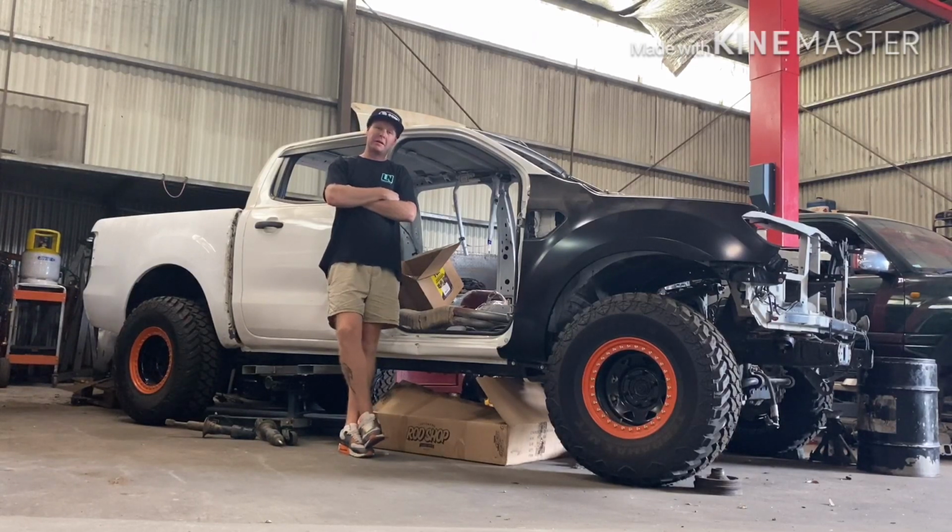So we've got the spare wheel mounted on the back wall inside the cab there. And we'll have a Raceworks fuel system mounted above the rear axle, so for weight distribution, keep it balanced out a little bit there. Now we'll get it down next for a cage, so that if we want to do larger events, we have that room to move and we're not restricted by how we've built the car. Also, our last video on the build of this one, we'll be racing it hopefully, so stay tuned.